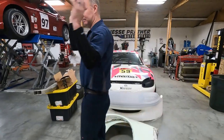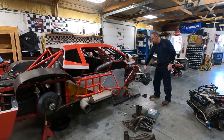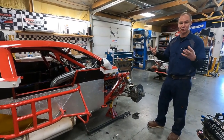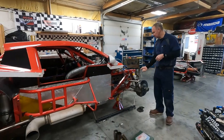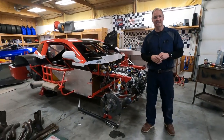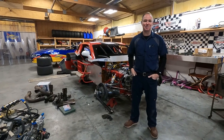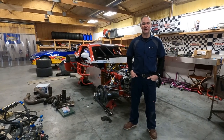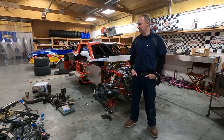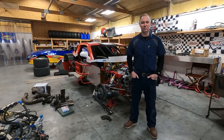Basically we're going to get this explosion taken care of here in the next week. It's possible the car will be done and gone. There are a couple other things I've still got to do — we're going to be putting some inner bump springs on the shocks so that the nose of the car does not bottom out above 150 miles an hour. There's so much downforce with this car now, and we need some little springs that should help prevent some of that. But we're looking good. It might look like a bit of a mess right now, but I know where everything goes. I appreciate you guys watching — we're just hard at it here in the shop, keeping busy, fixing cars. You guys just keep racing them and breaking them for me because I'll be here to help you out. Thanks for watching guys, have a great week.